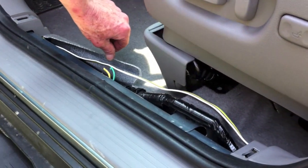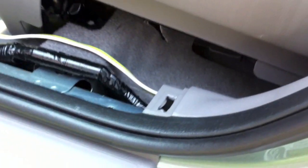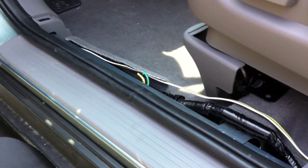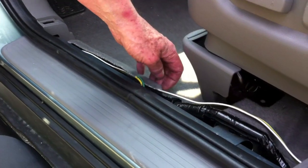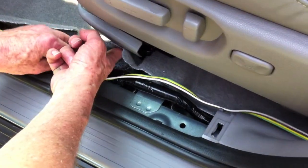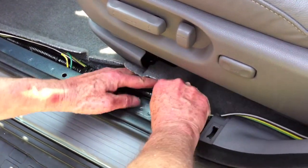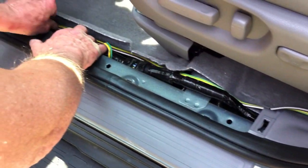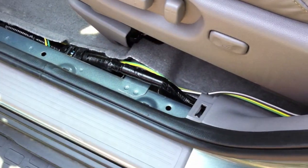Every car is done the same way. You'll be able to feed the wiring underneath the sill post between the front and the rear doors, and also underneath the rear seat. Just be careful that there's no area where a seat can sit on top of the wiring. This wiring, once it's properly installed, will be placed underneath the carpet area so that it's on the floor of the car. If there's any area where we think it might be damaged, we'll put some loom on it to protect it. Once it's installed, it's out of the way — you can reinstall that panel and it'll be done.